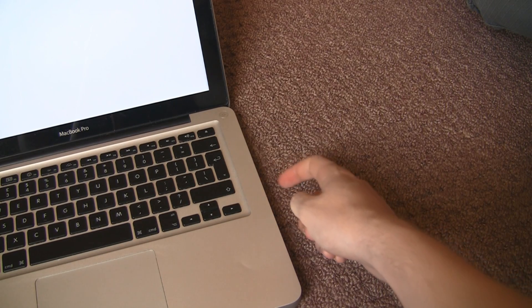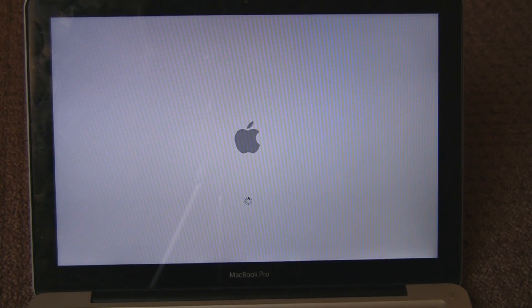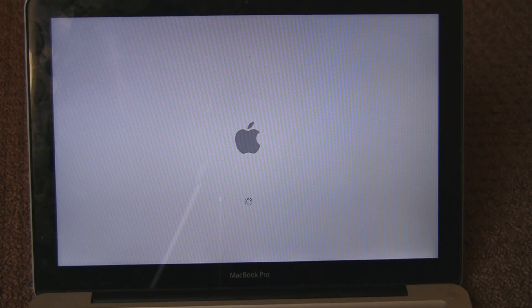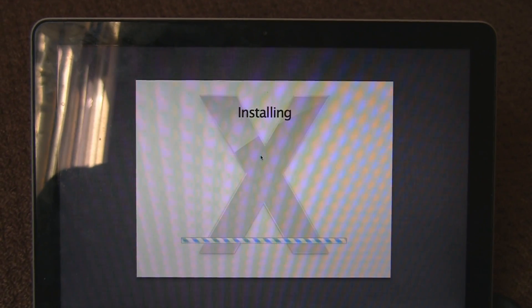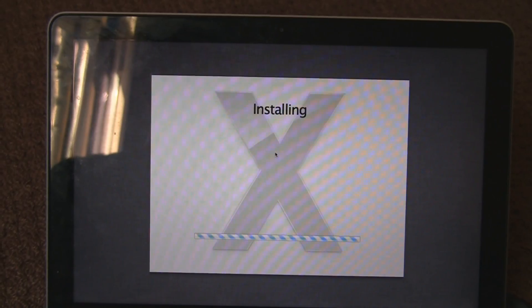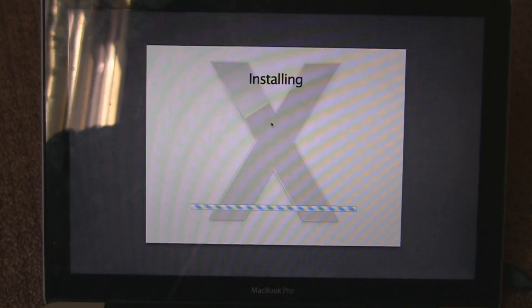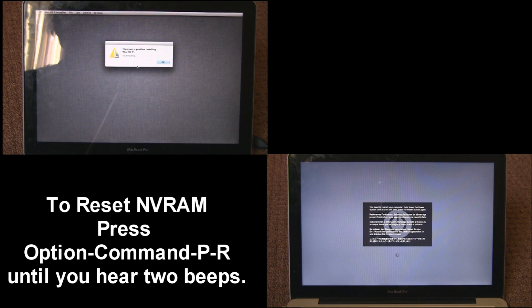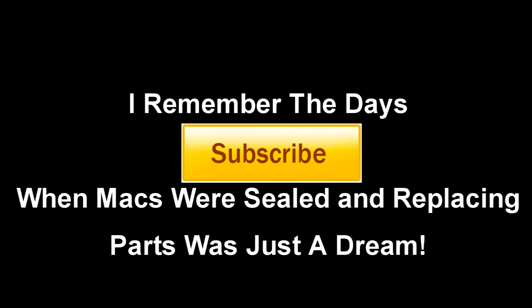Now comes the fun part. You've got to put your original Mac OS disks inside your Mac laptop, and when it boots up to this screen you know you're in right. You have to hold C to make it boot to disk and it will come up with this screen eventually after about 5 minutes or so — installing OS X 10. However, if it does not come up with this screen you may need to do one of the following: use your own Mac disk, or reset your NVRAM which you do with Option, Command, P and R until it beeps. Thanks for watching and don't forget to subscribe.